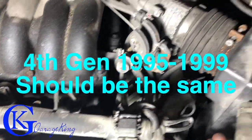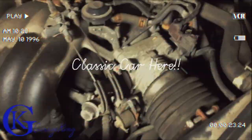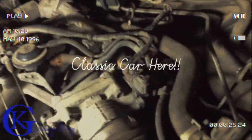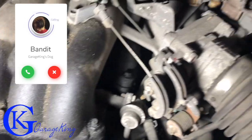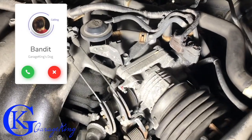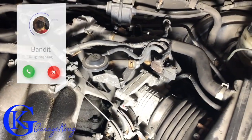So it's something to do with the EGR valve. These ones are known to have clog-up issues. There's an EGR tube under there, so we're going to take it apart, do an inspection — it's way under there — and let's see what we can figure out. Maybe we just need a cleaning and then we can get that check engine light off.